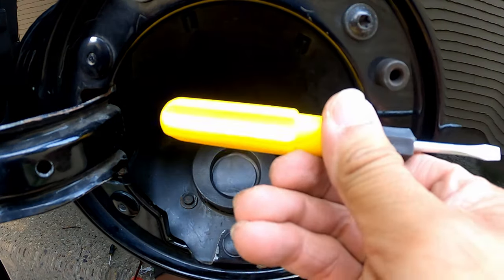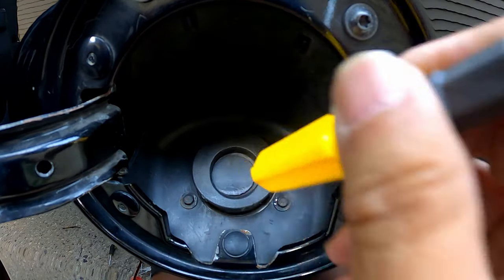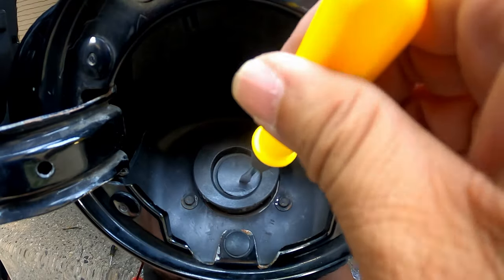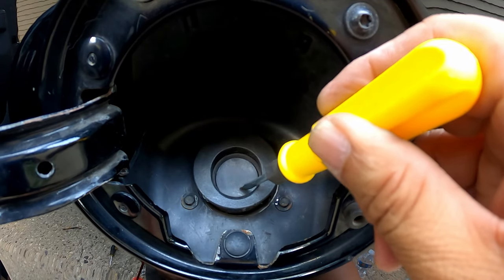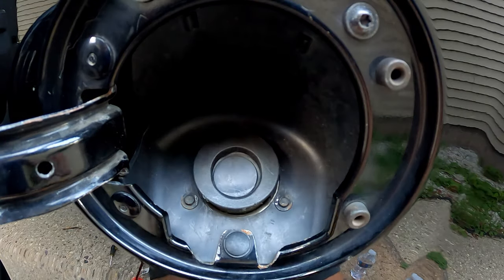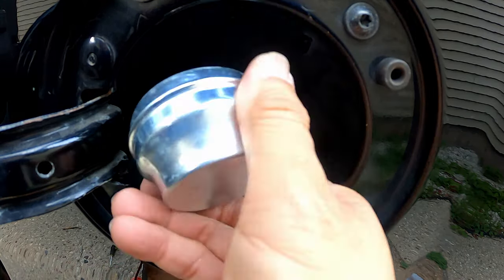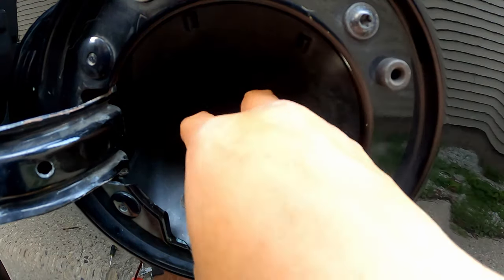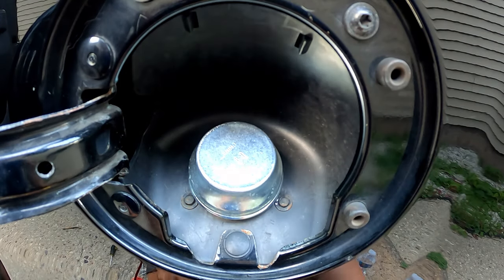Since it's fixed, let's pretend this is a nozzle for the fuel pump. Fuel pump goes in, push down — the second flap opens, comes back out, and closes back up again. Water had gone through this edge here during the car wash and sat inside, so I couldn't even push the lid in. We had to pick the ice out. But Chevy, please don't do this. To prevent water from getting in again, I found that a trailer hubcap — I believe this is a one and three quarter inch — fits right in. If you take it to a car wash, water can splash on it but won't go in there. When you need to fuel, just pull it out and fuel, then put it back in.